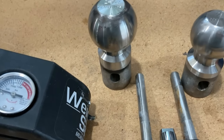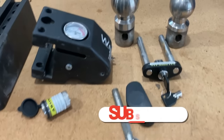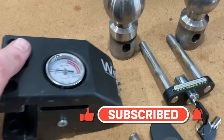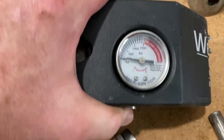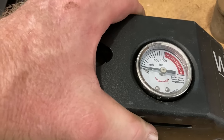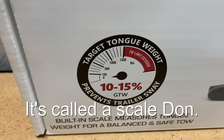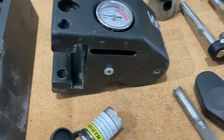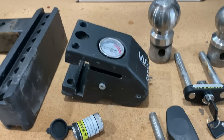That pretty much covers most of the trailers you're going to have. I recently got a five-by-eight that was about four years old — I thought I was going to need a one-and-seven-eighths ball, but it also required a two-inch ball. So I don't need to buy any extra balls. The cool thing is it comes with a tongue weight system so you can tell how much weight is on your tongue. The typical guideline is 10 to 15%, as most people who trailer hopefully know.